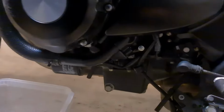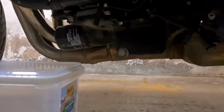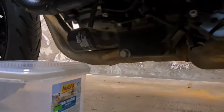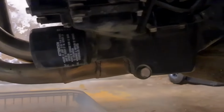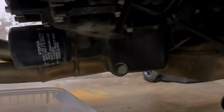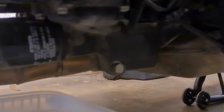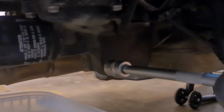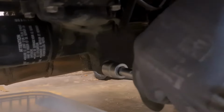So down here on the sump, I've got the bike on the paddock stand. And on the sump now, I'm going to release that bolt. And I'll try and do it in such a way that you can also see. It's a 17mm, perhaps this angle will be a bit better. And then once I've gotten it loosened, I'll get the bucket under and we'll start draining. So that looks a bit dark, but what can you do? Let's get this loose. Okay, that's free.